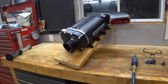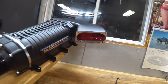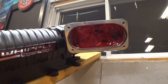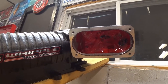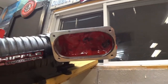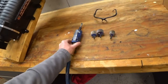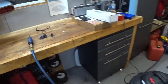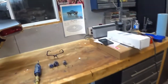I've got the Whipple up on a homemade jig, trying to use gravity to help clear the chips out. I sealed off the inside with vapor barrier tape, cleaned it first with some throttle body cleaner so it would stick, and put some blue shop towel in the back and taped it off really nice — shouldn't get any chips in there. I'll be using a die grinder with a bit, a couple of flap wheels, safety glasses, and I'm also going to run my shop vac at the same time to try to suck up all the chips.